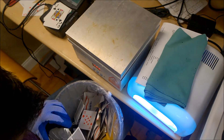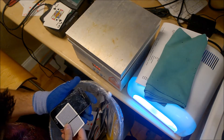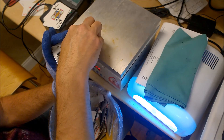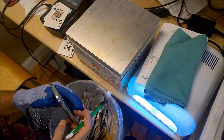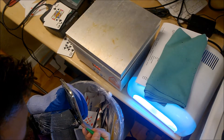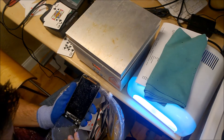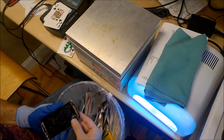If your lights on the bottom adjacent to the home button do not turn on, you have to remove the AMOLED from the midframe in order to replace the part that lights them up, and that will generally mean you're going to break your screen. That's the way this phone is designed. We're going to be at the final stage of removal here in just a second. You can see he's gone back to the razor blade to separate these from the lens very carefully — don't want to cut through the cable. You'll want a trash can below you because a lot of little splinters of glass will be falling everywhere. He's also got a glove on because these surfaces get very warm and will burn you.